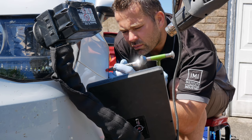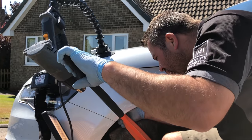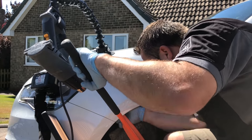Again, more tapping the crowns down. This time I'm using a cherry tip on the end of my knockdown. This tip isn't too sharp and it's not too soft, so with moderate impact from a hammer you're going to ease the crown back down to its natural shape.